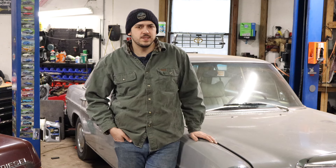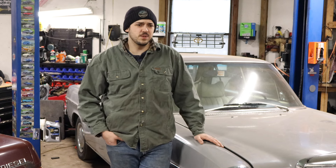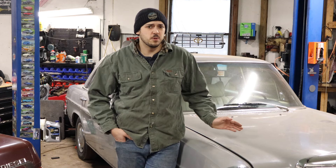Previously had KJET running on it — full mechanical fuel injection, fuel distributor, warm-up regulator — and still using the EZL. I couldn't get the fueling to be tuned quite right on it, so I made the choice to just leave the EZL as an ignition controller stand-alone thing for now, and then just use a fuel-only version of Megasquirt. We've got a fuel rail from an M104 fuel injected in there.